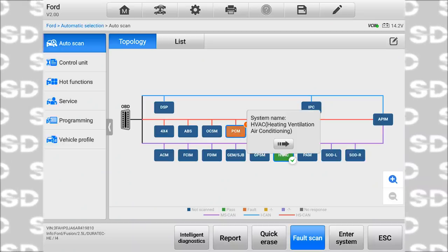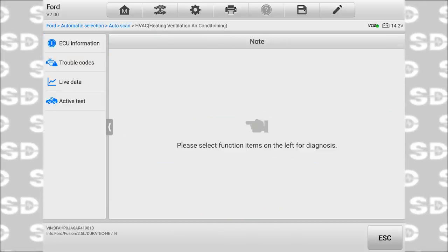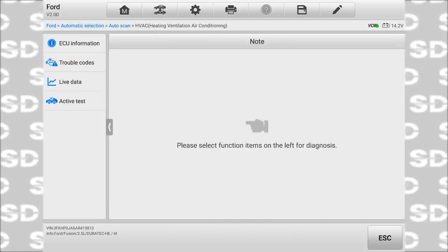We'll go back to our climate control panel. And I just want to make sure my EVAP temp sensor circuit isn't messed up on this. Because they'll use an EVAP, not like the EVAP system for the charcoal canister and the fuel tank, but evaporator. So we call that an EVAP as well. And that can be a little misleading or a little bit confusing for some. But this evaporator core would have a temp sensor on some cars that makes sure that the EVAP doesn't ice up. And that's an important input. So we want to look at that.